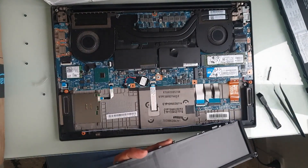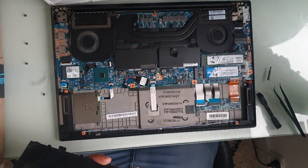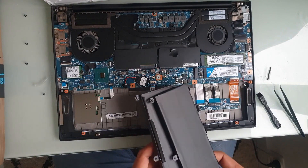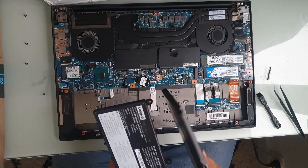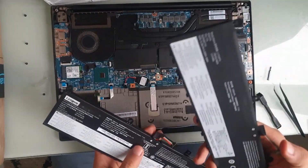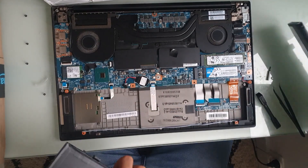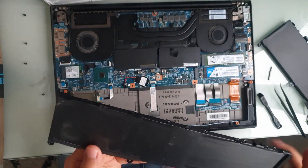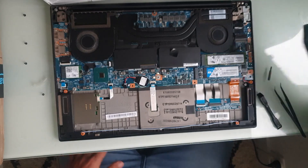I can see one problem: the original battery has cushioning — like a sponge — for vibration, and the new one doesn't have that. I'm also worried about the wires — they seem pretty thin on the new battery. Also they come out straight rather than at an angle like the original, which means the connector will have stress on it. Anyway, I think if I try to remove the sponge padding it will be damaged, so I'll probably add my own cushioning later when I have the right equipment.